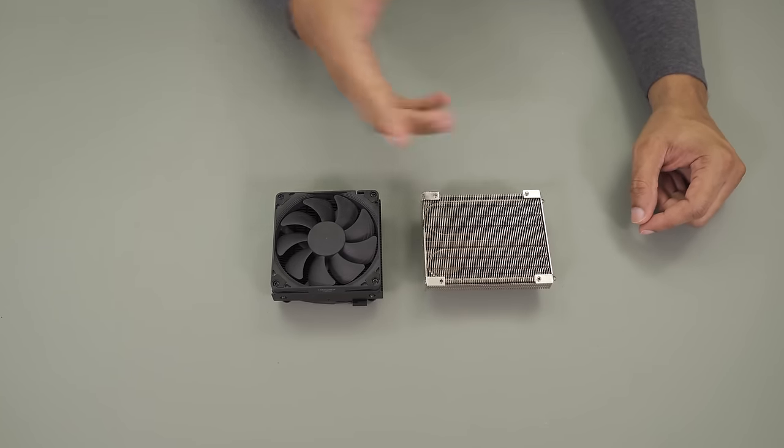The GPU seemed to have a much easier time. At idle it was sitting at around 49 degrees C, very comfortable for a typical GPU. Under load it was touching the 75-80 degree mark — what you would typically see from a compact desktop card. I wasn't seeing any throttling even with super intensive games pushing it to its max. The case does get a bit heat-soaked at times, so you will feel the temperature on the outside rising, but it didn't seem like that was actually affecting the performance.